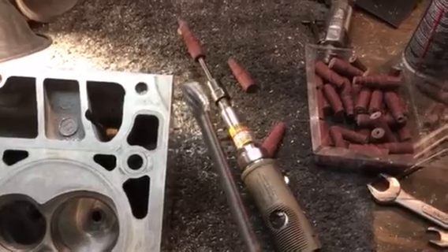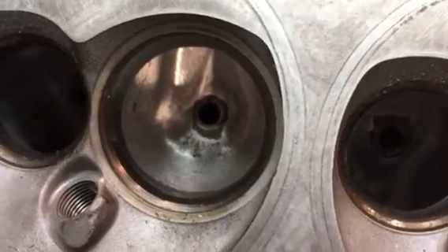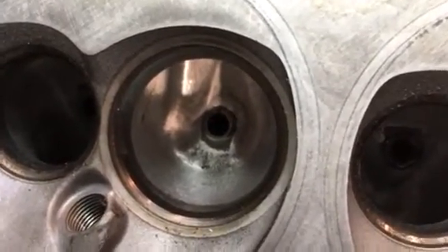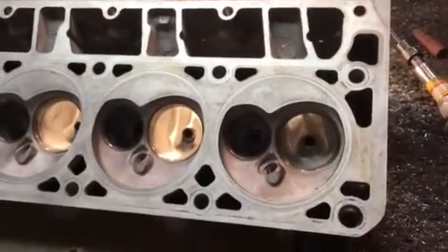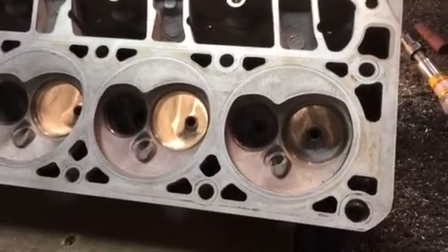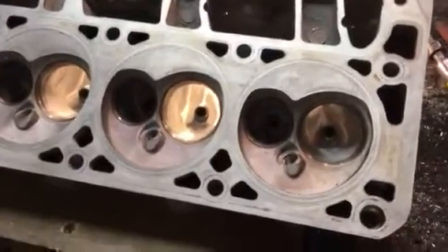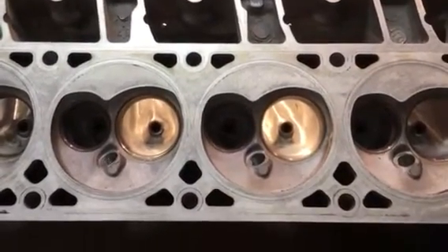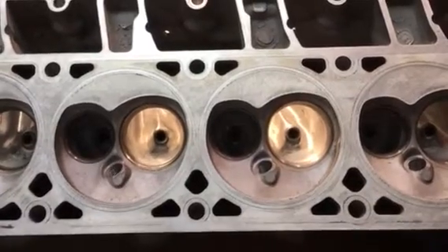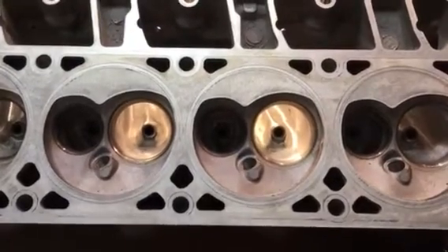This is the type of burr I use to get that finish. When you start doing head porting, you want to smooth out those rough cuts — hopefully you're not gouging too deep. If you want to start smoothing out your rough hog-type cutters that leave big jagged nicks in the port no matter how careful you are, come back with a double cut and slowly work that port out to get the look and shape you're looking for. This was part of the sanding roll work on these 241 heads, showing everyone how I'm getting the heads to flow and look the way they do.